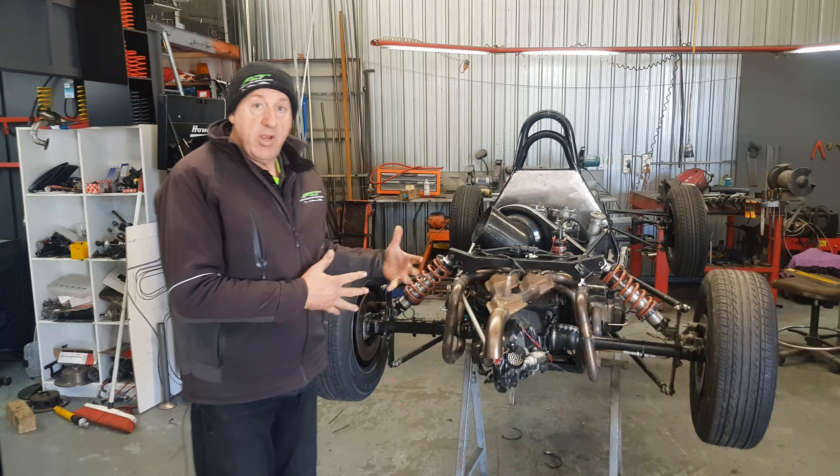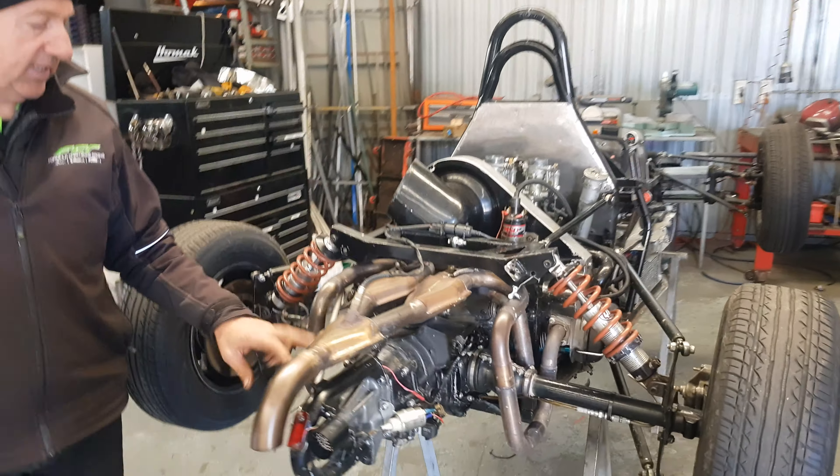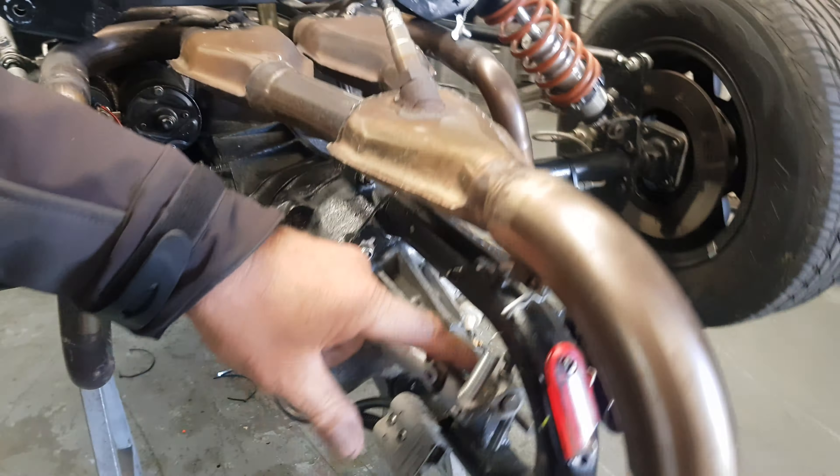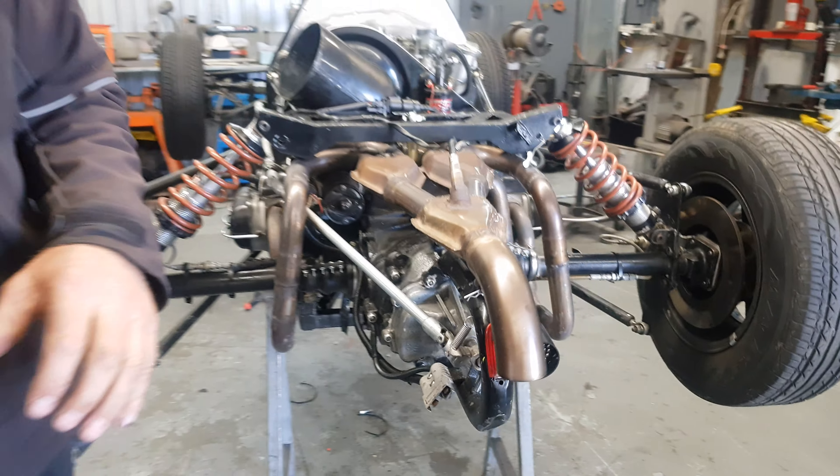To start with, we'll start from the back of the car and work our way forward. So the gear change is always a good one — there's a nut down here where the gear change goes onto the shaft that can actually get loose, so make sure that nut's nice and tight. You've got no play going forward and back, you don't want that sloppy. All the way up through the gear change you want to make sure there's no play, it's all nice and firm.